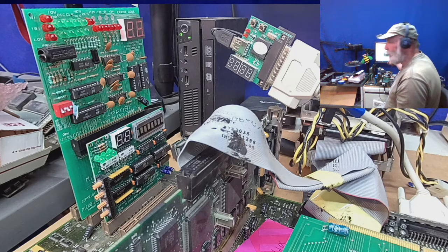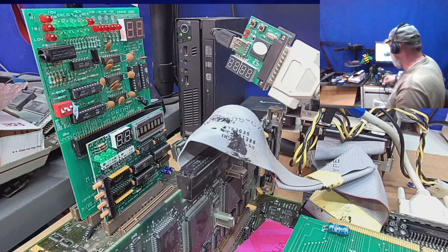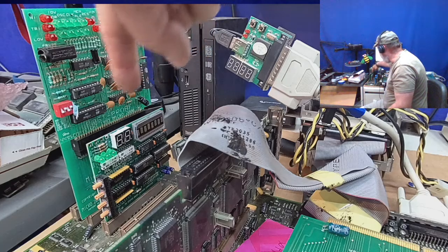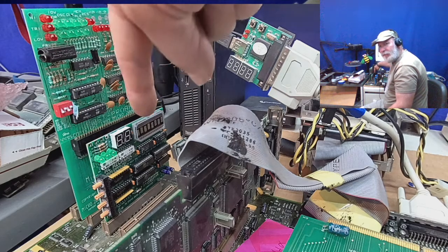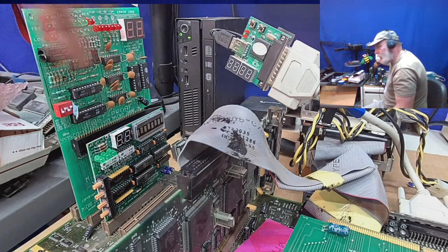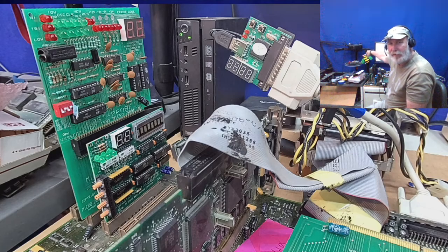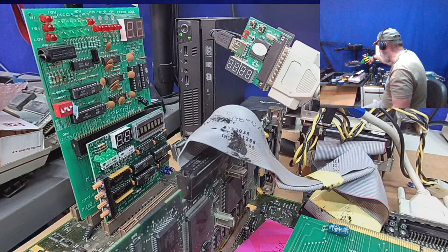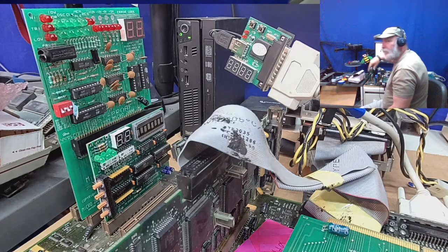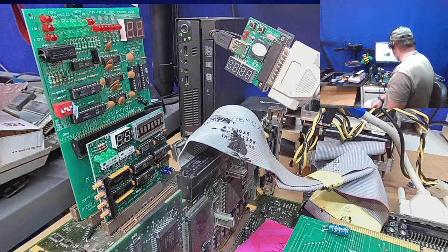I just actually flipped it. It's actually kind of upside down, but that's probably a real good view. Of course, we have the MC Mechanic in this slot here. It's actually slot 3 of the planar, doesn't really make any difference. These boards do not need an ADF or anything else like a conventional Micro Channel board. And then on the interposer above that is one of my other postcode readers.